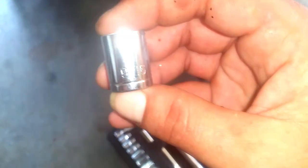We're going to break out some tools. A 9/16 is the magic size that will fit this just perfect. Something to keep in mind before you take the blade off: note which way the blade is facing. In this case, this is the blade side — it spins this way. That's one thing to keep in mind so that when you take it off, you don't put it on wrong when you put it back.